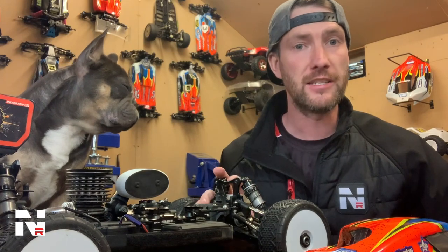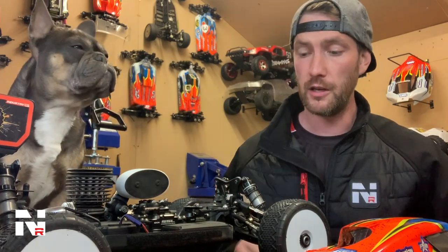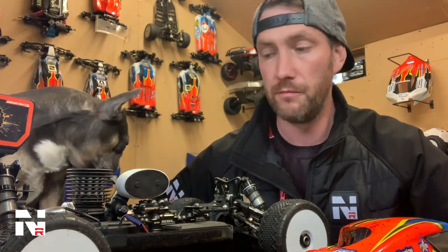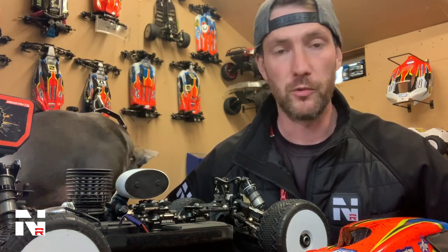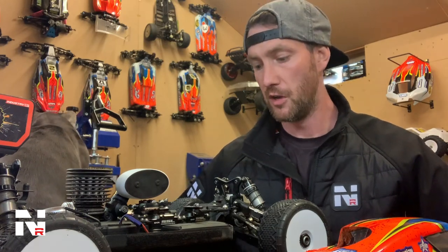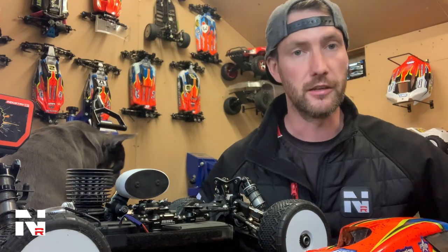The shock package — these are the biggest shocks on the market. They are 17mm big bore shocks, unlike your conventional 16mm. So you get that extra bit of oil displacement and you get much better bump handling, and jump and landing feel. The shocks are very impressive. We've worked on them quite a bit and it's amazing what you can make them do over big jumps and bumps. We always use our own product, our own springs — we don't go looking elsewhere.